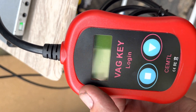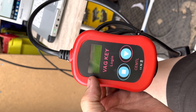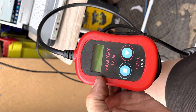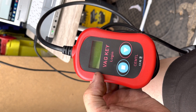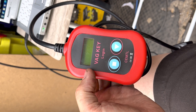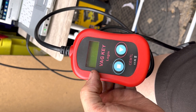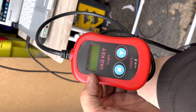The reason this is useful is, say for example you have a bad ECU and you replace it. With this little gadget you can read the PIN code of the ECU, but you can't match it to the vehicle because what it's going to ask for is the PIN code of the instrument cluster — the PIN code of the car. If you don't know the PIN code, you won't get it from VW, that's guaranteed. So what you need to do is remove the cluster.